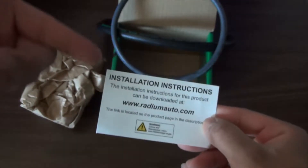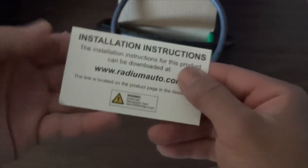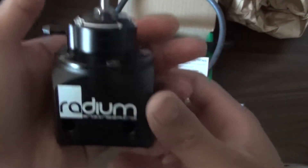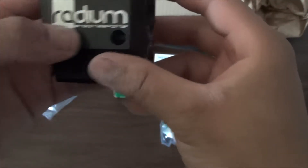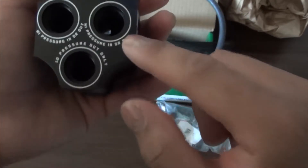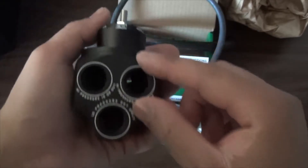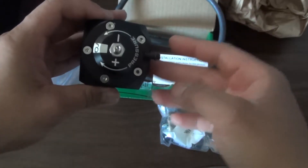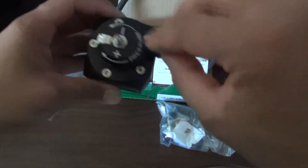Got installation instructions — I will be doing an install on this one shortly. This is the FPR body with your adjustments right here. This is your high pressure in or out, and low pressure out only. It's pretty nice, all labeled, solid aluminum piece. This will also work if you have aftermarket fuel rails with AN fittings. And this is your low pressure out only where you can put your fuel pressure gauge and actually adjust it.